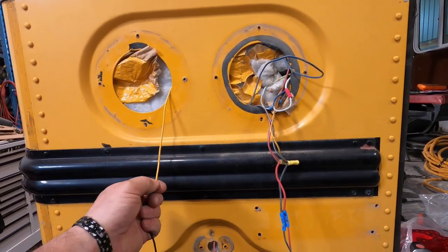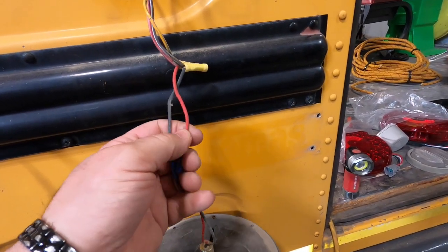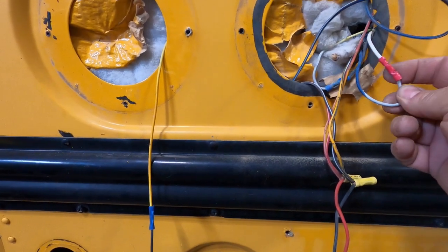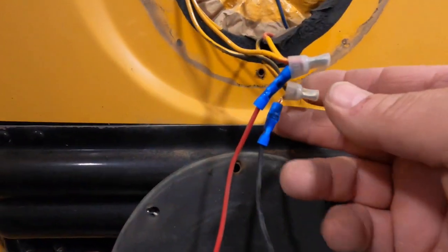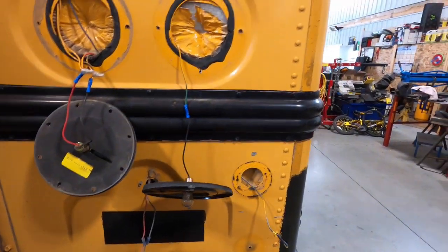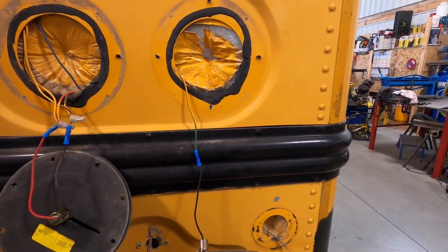At the very least you should remove your lights and check the wiring and the crimp ends here, the butt connectors, because as far as I'm concerned these are just temporary. You can see they've replaced this light bracket here with another one and they've just crimped half an end on it. The wiring is not very spectacular here. Look at this side over here — see the bare wire there? That's how you chase problems around the bus because this could wiggle, touch the frame, intermittent problem, maybe blow a fuse, maybe the light won't work and you'll be chasing it forever. So check and repair all the connections. Soldering and shrink wrapping is the only way to do it that's permanent.